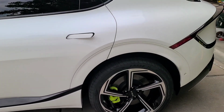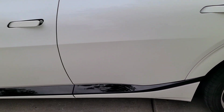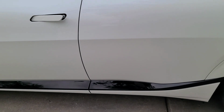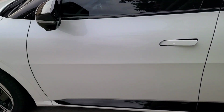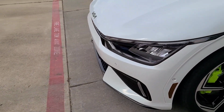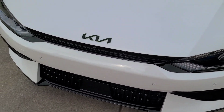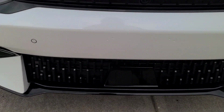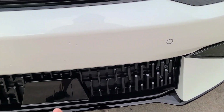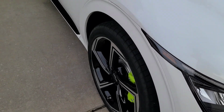Alright, so real quick what I did, I pulled it outside so we can check for high spots. I can see down on this panel down here, it's a minor amount. I'm doing this because I just finished applying the coating, and it's better to get ahead of high spots. You can have all the lighting in the world, you're not going to see anything like the sun's going to show. So I got some down here.